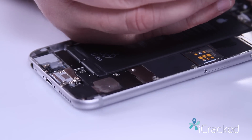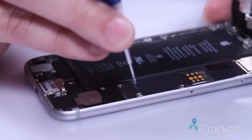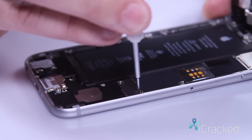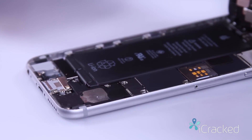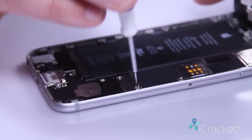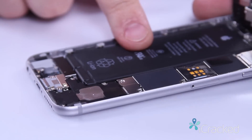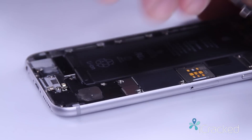The reason for disconnecting the battery is because when you set your phone to January 1st 1970, it caused an issue where the CPU doesn't know what to do. It's been rumored that it's an integer error, which basically causes it to crash, and by disconnecting the battery and reconnecting it, that sets the time back to normal and will allow the phone to boot back up.